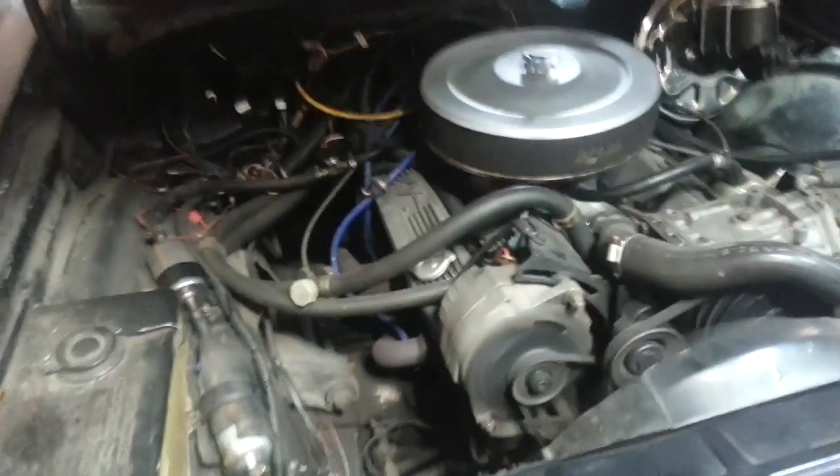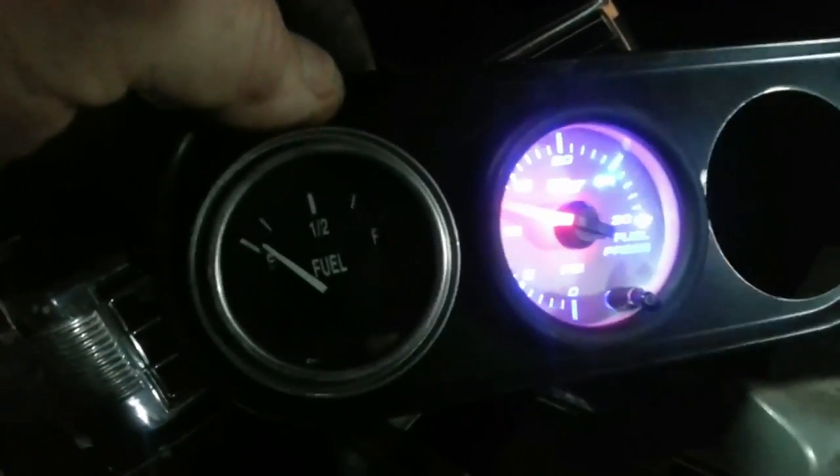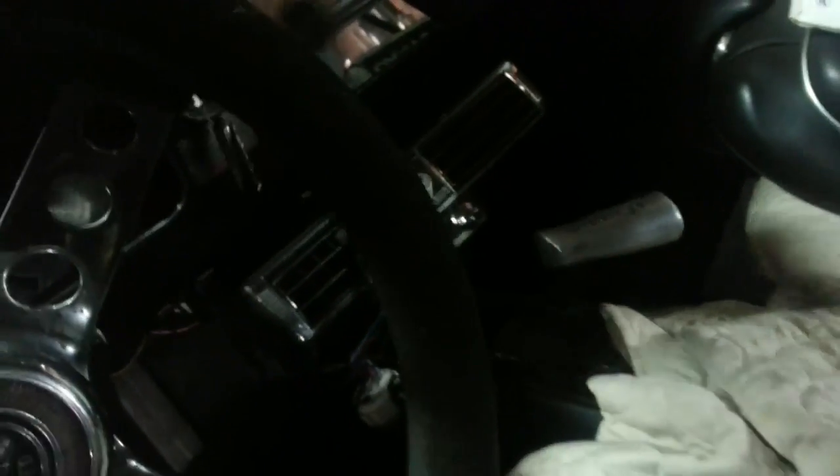That's the sensor for the Glow Shift fuel pressure gauge. In the case of the Volkswagen water boxer engine, the regulator sets the pressure to approximately 30 PSI, and for the TBI system that the Chevelle was converted to, it sets it to approximately 14 PSI.